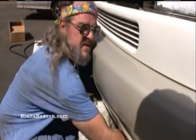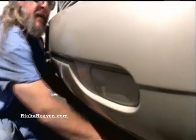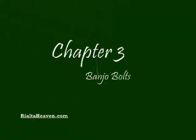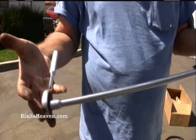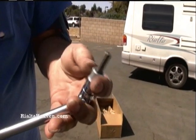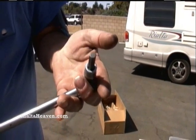Put the drop cloth up in there. Original shower curtains work really great for this — they're not good for the shower but they're great for a drop cloth. You just leave it in there. I try not to loosen the banjo bolts on the cooler until I'm sure everything's here — you don't have to worry about any leaks if you have to put it back together. This is the ratchet, long extension, swivel joint, and 8mm hex — that's what takes the banjo bolts out.